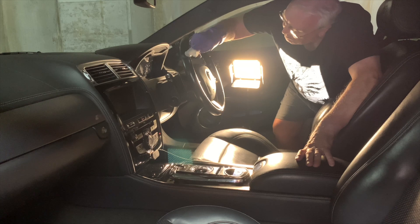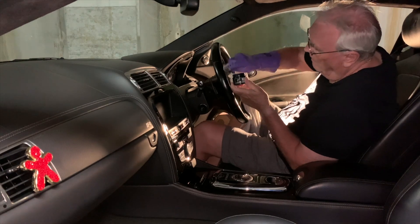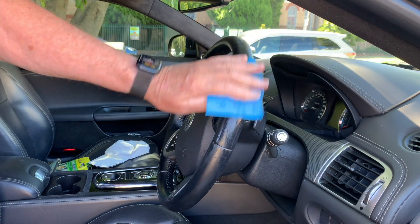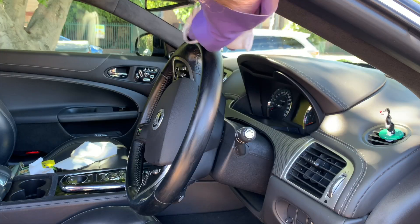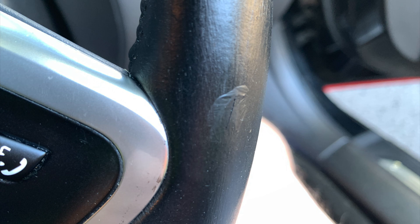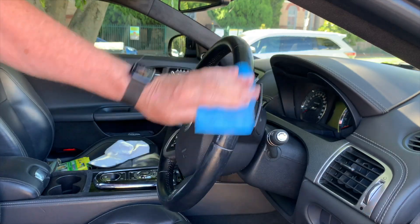This is handy if you live in an apartment like me where it's too dark to see what you're doing when applying color in the parking bay — it means I have to drive the car outside into daylight to do most things. Let the color dry hard for a day or overnight. When you come back you'll find some uneven spots, especially if you've brushed the color on. So you're more than likely going to sand again very lightly, then recolor the whole wheel. The gouges are still likely to show, so paint those thickly so that the dye protrudes from the rest of the wheel — you'll come back and sand those off later.